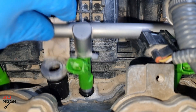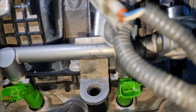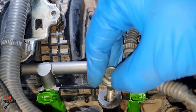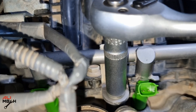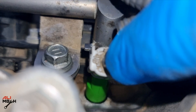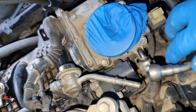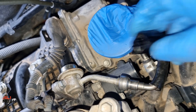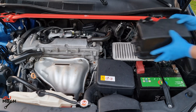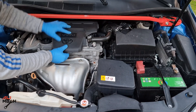Let's take the bolts and spacers out — they are all clean. Let's install everything back just like we removed it. The installation is way easier than removing. Align the fuel injectors and put the spacers on. Make sure all the fuel injectors are inserted in their holes. Now put the two 12mm bolts on and tighten them. Next, connect all the fuel injector harnesses. Don't forget to tighten the cable brackets. Insert the fuel line back, put the cover on. The engine cover is on — that's the last thing.